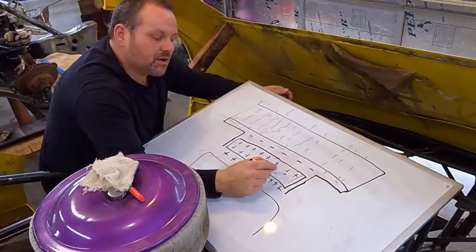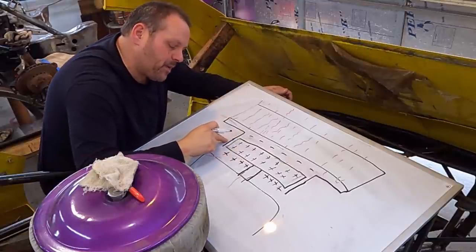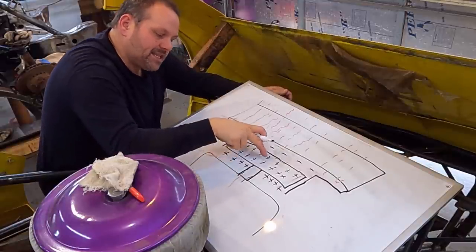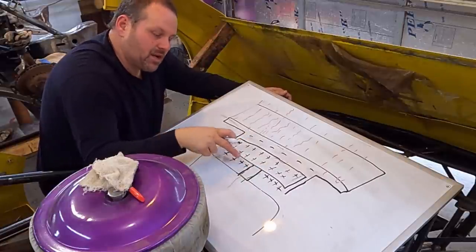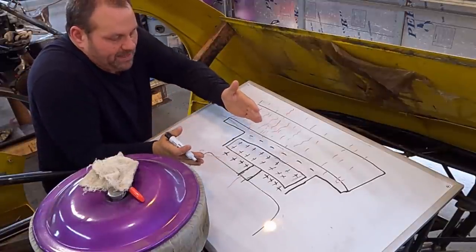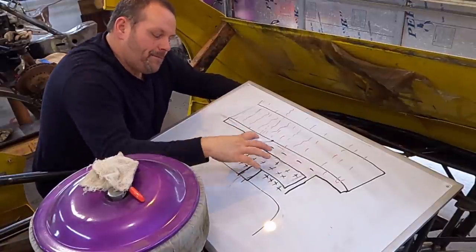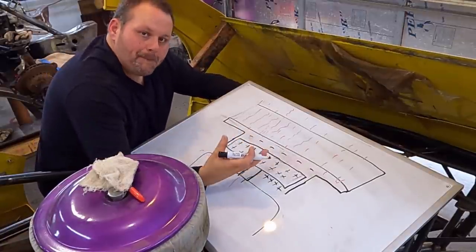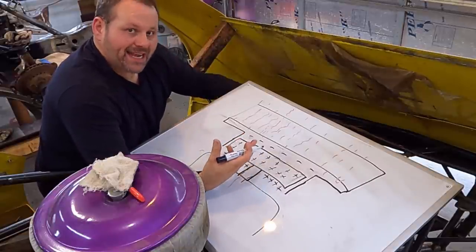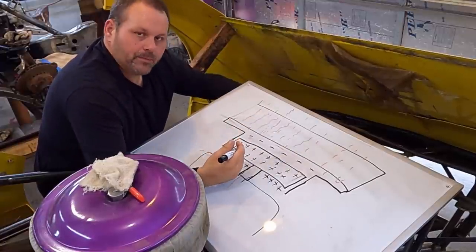But you've got all this pressurized air right here. And that leading edge right there, any fan shroud that goes past that, all it's doing is delaying its exit point, okay? What it's doing is limiting the amount of air that it can pull through, because this air right here will reach a maximum pressure where above whatever that is, increased RPMs won't pull more air through, all right?